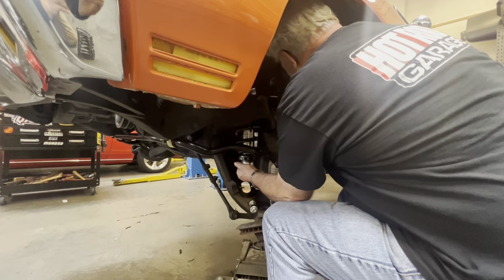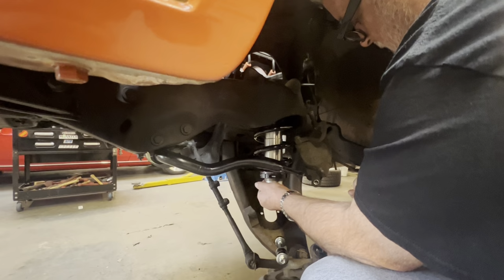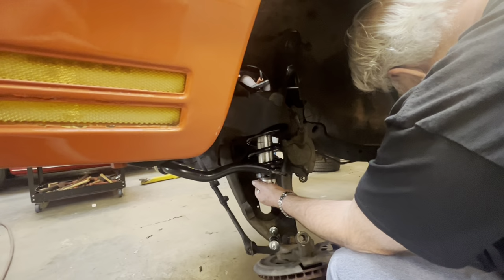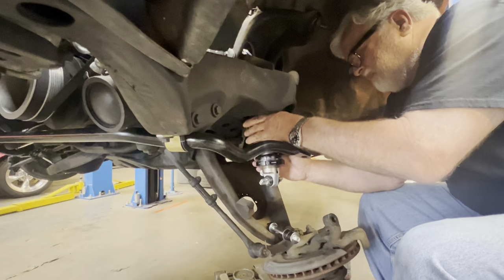Alright, so you can put the washer on without the rubber grommet and one of the nuts at first, because it needs to see a little bit of compression. Hey, can you go over there and grab me the nuts for the actual shock? These are flat. So you just need to find the right spot for me to lock in. Should be fine.